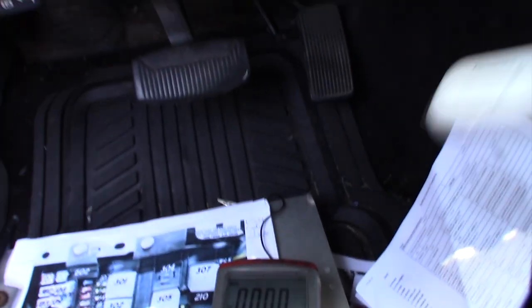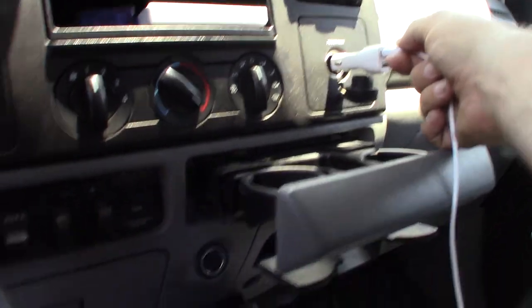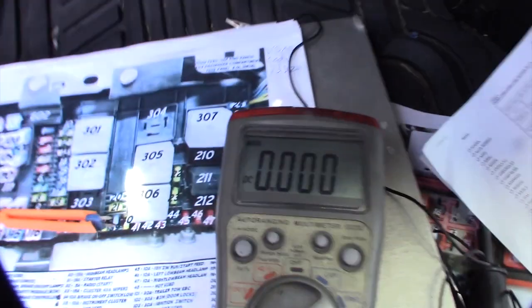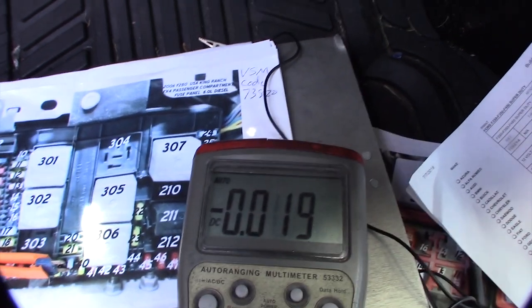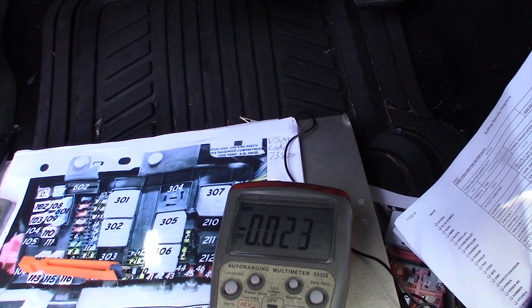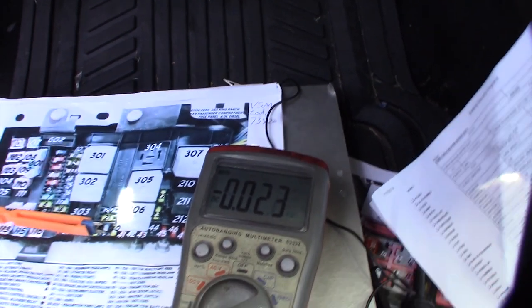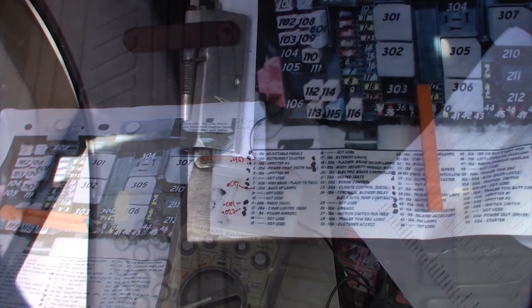This one drives my USB power connector — it draws about 0.23 amps right now with it connected to the power point. I'm going to plug in a device now — observe the multimeter. So that little LED on the device draws about 1.2 amps. All right, so that's probably what I was seeing before. Cool.